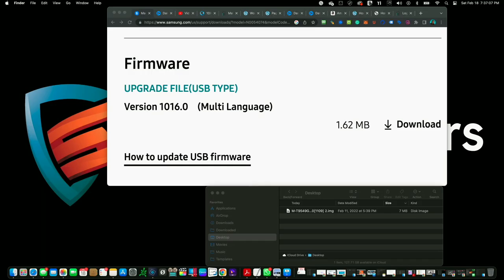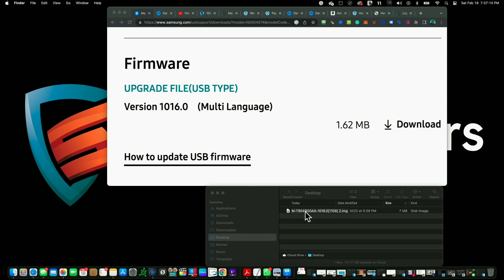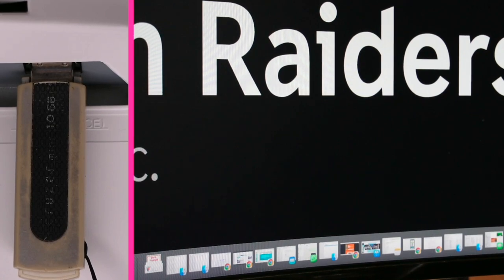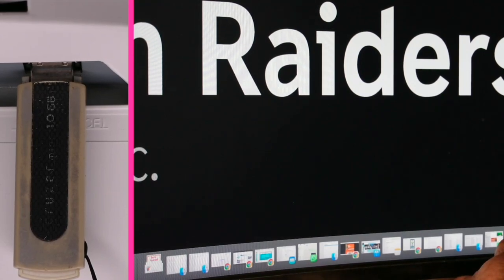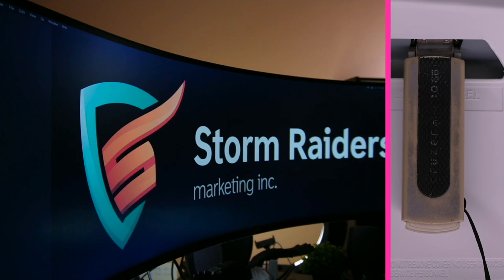Click to download the file to the desktop, and when it downloads you're going to expand the file and transfer it to a USB drive — it should be an IMG file. Get a USB memory stick, format it for FAT32, and place the expanded files into the root. Behind the monitor there are two USB-A slots; one is for servicing.